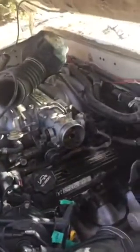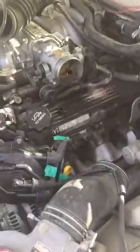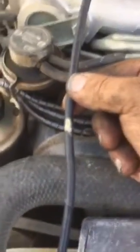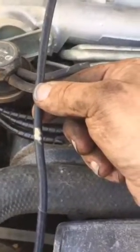All right, guys, looks like we're all wrapped up. We got all 6 plugs out, all 6 cables rerouted. I still got the air cleaner off that throttle body just because I want to start it up before I put everything back together. And see, I want to show you real here one of the reasons we decided to do this. Obviously too late from the look of those spark plugs, but it looks like a mouse or something had been in here chewing on it as well. So we figured we just would change all the plugs and everything.